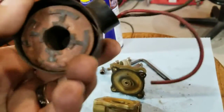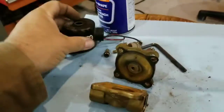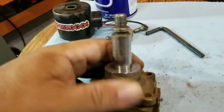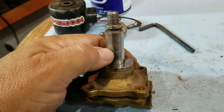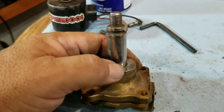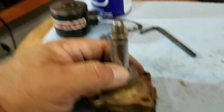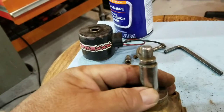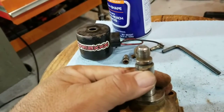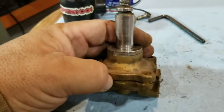This is a magnet — it's an electronic magnet. This electronic magnet pulls a pin up. The pin is inside of this. There's a spring at the top inside and a spring at the bottom. The spring at the top holds it down. The electromagnet engages and pulls that pin up, which allows airflow to go through your valve.